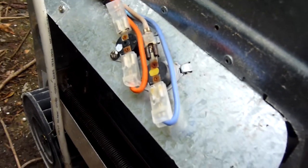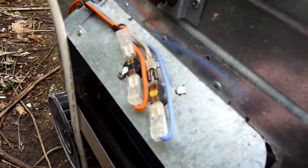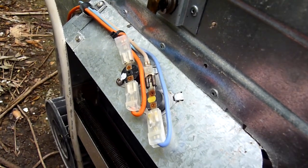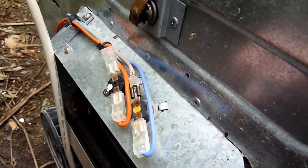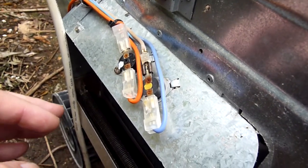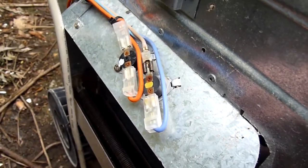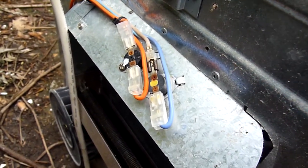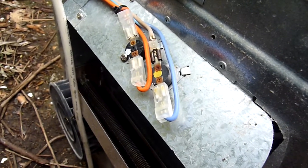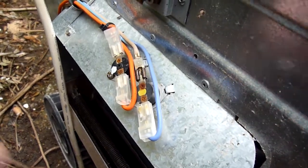And what I'd gone and done was I put the thermostat in, and it was tripped, so it didn't work. It broke the circuit, and it wasn't some time before I realised, but I had to get a paper clip and reset that. But the tumble dryer then started heating up as it should do. So that's a lesson for me, and a bit of advice for you.